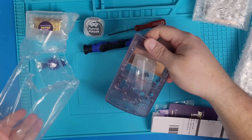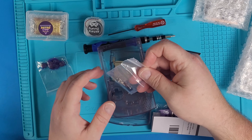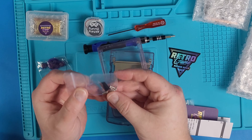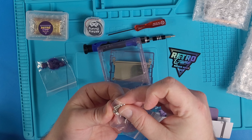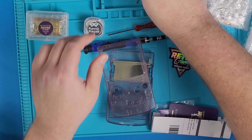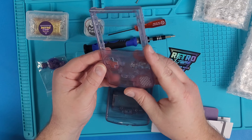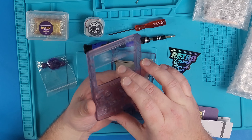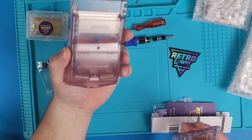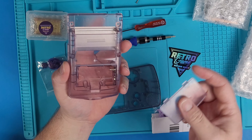After I cracked into all this, I just looked at everything and made sure everything was there. We have the IR sensor cover at the top and all the screws — the six tri-wing screws on the back, and three Phillips screws that go on the actual board. Don't put the third screw in the center because it causes issues. And when I show you the part where I actually put this all together, we will see all this happening.